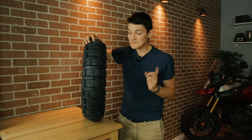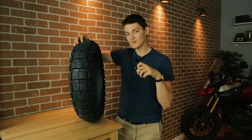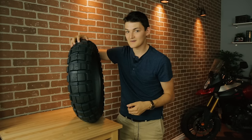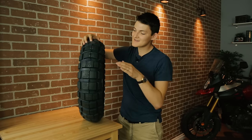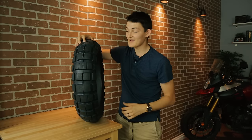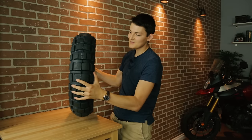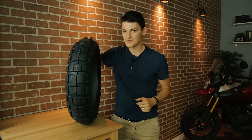There are differences off-road. Because of this paddle formation, the Shinko tends to hook up better in the soft stuff. It'll pull harder through the mud and it'll climb higher on a sand dune than the TKC80. But there is also a distinct lack of lateral grip with the rear tire, again because of the paddle design. So you'll notice the rear end on the Shinko E805 is going to slide side to side very easily, whereas the TKC80 runs a bit more true.